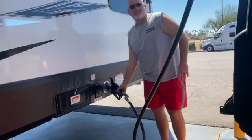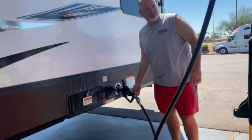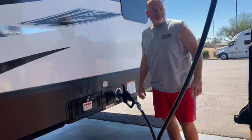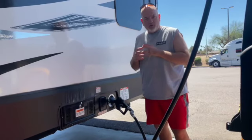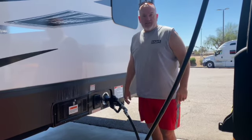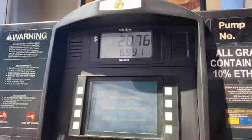Now testing the fill — it's going in on full trigger. It's on full! Couldn't do that before. Yeah, that worked! I think part of the fix was that ball that was sticking in there. It's never taken fuel this fast, even brand new it didn't do this. So hopefully moving that ball and dropping the fill neck a little bit should help. I'm going to put about 22 to 24 gallons in. If your tank's not filling up good, definitely try this fix.